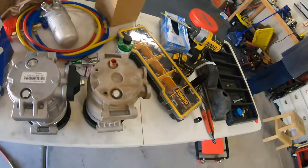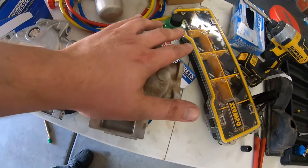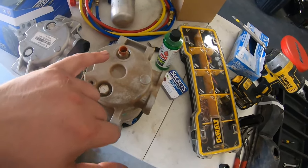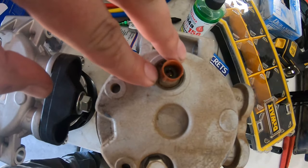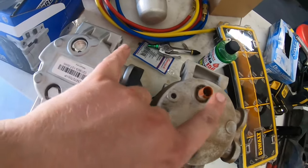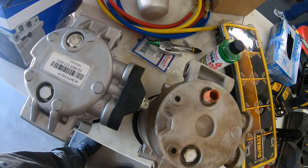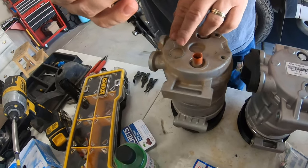As far as your compressors go, this is our new one — it's a Murray. This is the one that was switched out last time, and it's not OEM. This little switch on the back right here — there's a snap ring. You're just going to grab the snap ring, pop it out over here with our plug, and you're just going to take the switch and swap them. You're going to make it look like a master, just like that.